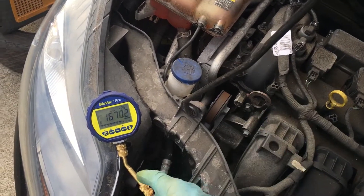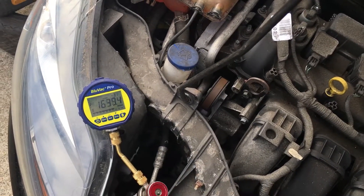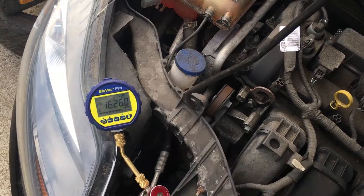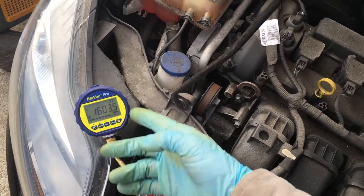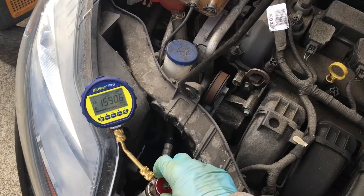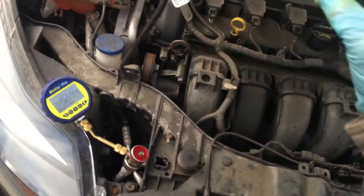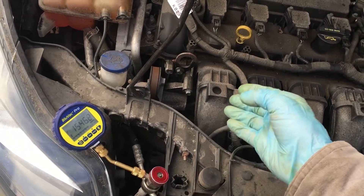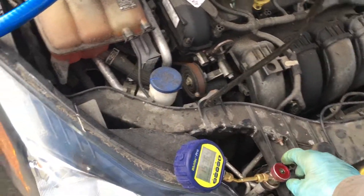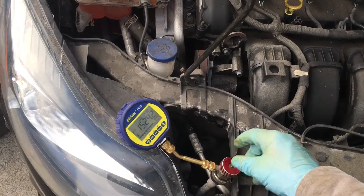I know this is a really wet system by how long this is taking. If this were a completely dry system, I'd probably be down to around 400 microns right now and it would stay steady with just a slight creep up. But because the system is so wet it'll stay here for a long time — possibly an hour — watching this. It's PAG oil, POE oil, and this would be like watching paint dry trying to evacuate it completely dry. They did not change the receiver dryer or the desiccant material. This vehicle had a hose snapped off two years ago and was left exposed to the atmosphere for two years. Family and money problems for the customer, so it didn't get repaired until now.